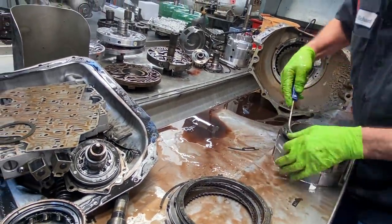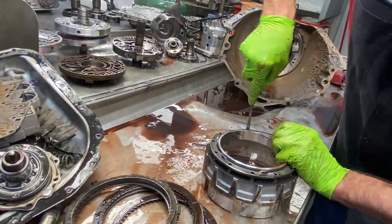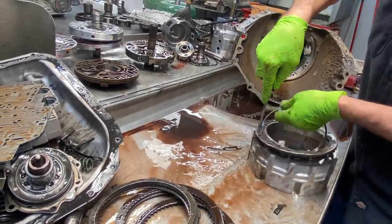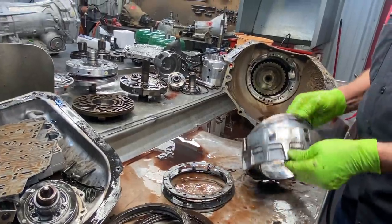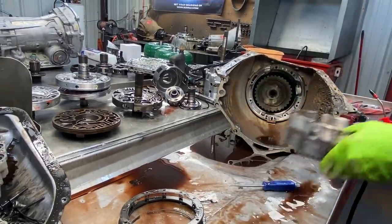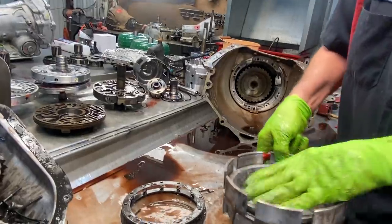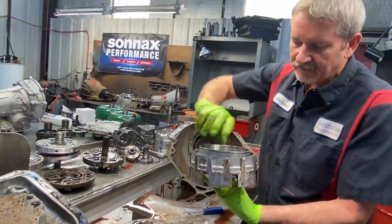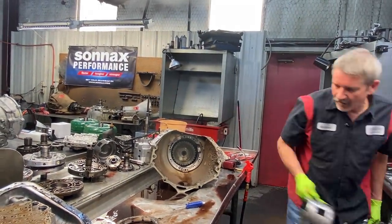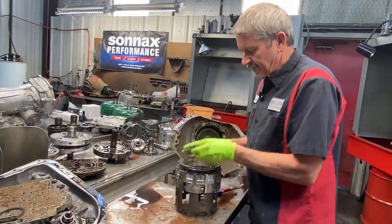Now a lot of people find this really tough to put back together. You have a seal here and a seal here, so when you set that in there you've got a feeler gauge all the way around, then you flip it over and feeler gauge that around, then you've got to get it to pop in. I'll take it, put it on a shell, then come in here and put my snap ring in like that.